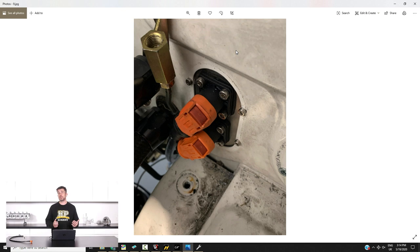One of the jobs Brandon's been doing is battery mounting, as well as wiring up the main power feeds to the starter motor and earths. Finding a neat way to run your battery cables through the car can be a little bit tricky. We've taken the opportunity to mount a smaller battery inside of the cabin, since there's not a lot of room in the FD RX7 engine bay. This means we need to get the battery cable through the firewall. Rather than an Autosport connector — which gets pretty pricey once you've got the crimp tooling required for large-gauge contacts — what we've done is go with the Amphenol Radlock system. I've got two feeds coming through the bulkhead there where the factory air conditioning used to be, having removed the aircon out of the car.